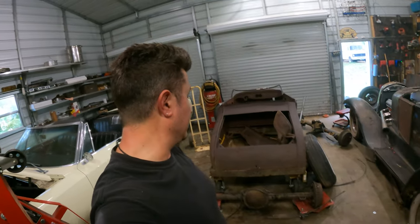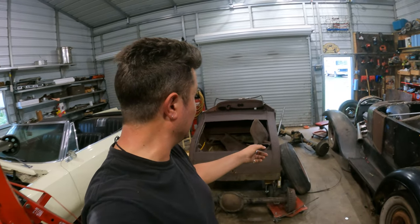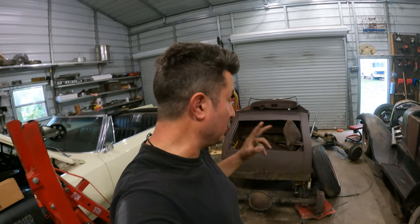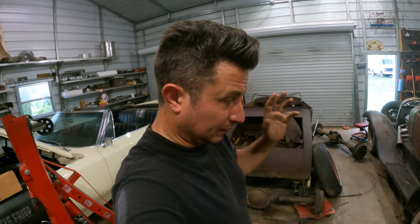What I do have around here is this S10 rear end with 3.08 gears that matches several transmissions I have scattered about. It was too narrow for this one because the body's real wide on the back end. It appears all right, so I'm going to go ahead and mock this thing up with two 8.20-15 tires on whatever wheels and whatever backspacing and see what the deal is — see what parts I may or may not need in order to run this rear end. The S10 width and all this stuff is a serious debate on some of the forums, so I've got one.